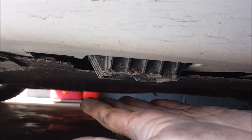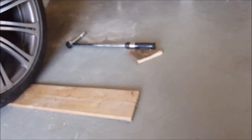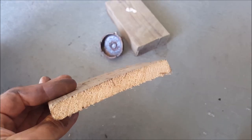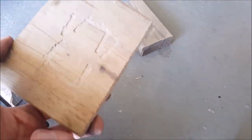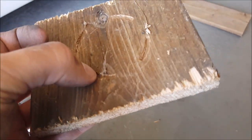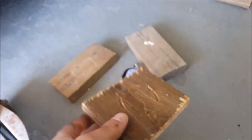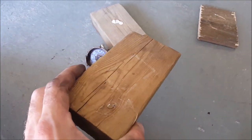It's a Sunday, the BMW dealers are closed, so I said forget it, I'll figure it out myself. I'll show you how to jack up your car without that BMW accessory. I started with a 1x6, basically a piece of fence wood. I cut it, made it as small as possible and tried to use that to jack up. The problem I encountered is the car is 4,000 pounds, and the wood started to crack and make sounds like it was going to buckle and disintegrate. I wasn't comfortable continuing because I didn't want the car to fall and get damaged. So I went looking for a 2x4 and that solved the problem.